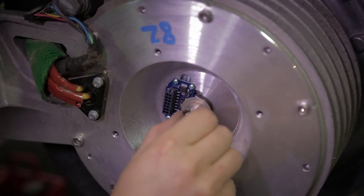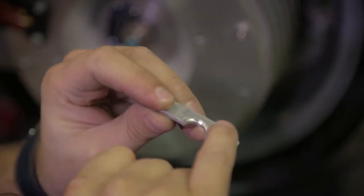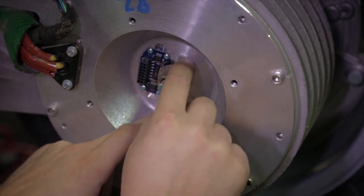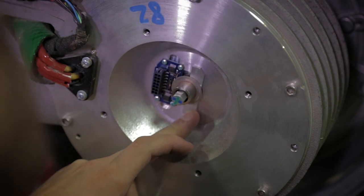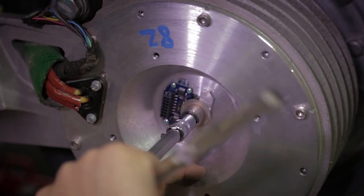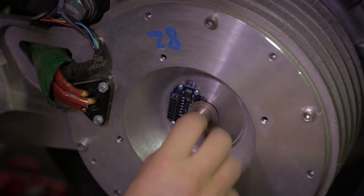Let's place the disk, being sure that it is clean and straight and not bent. Back in position, keeping this bolt loose. Then we place the second tool — there is a part sticking up. We place it here and push the disk into position. This defines the depth of the disk. Then we tighten the bolt to lock the disk in position. Apply the brake, and remove the tool. The disk is now locked.